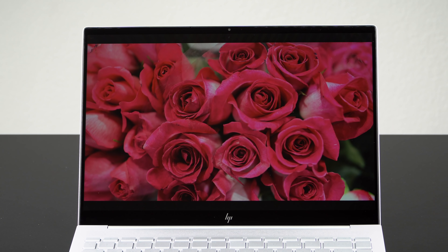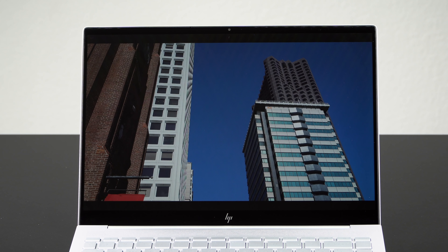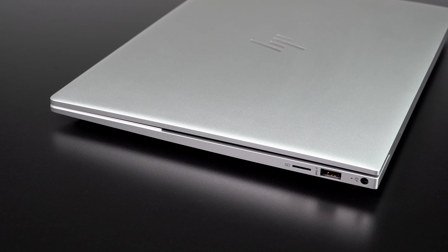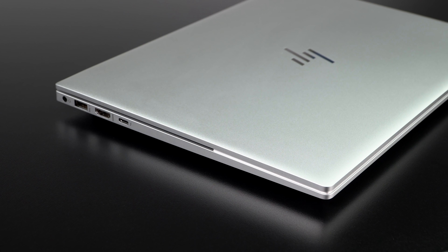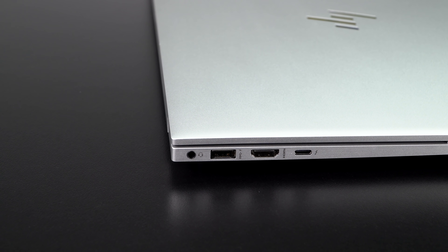It's a pleasant display — up to the job for photo or video editing, and looks great for media consumption. For a relatively compact laptop the port situation is pretty good. With Intel 11th gen we get one Thunderbolt 4 port, which is also USB-C, handling display out, Thunderbolt docks, and USB-C docks. There are also two USB-A 3.1 ports at 5 Gbps, HDMI 2.0b, a headphone jack, and a microSD card slot — so no dongle life here, which is a bit more appealing than the Spectre x360 in that regard.